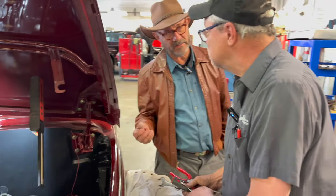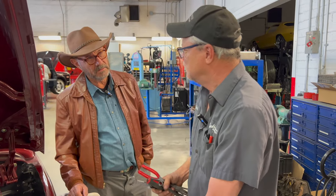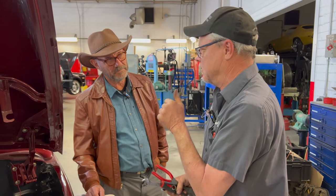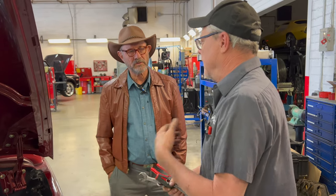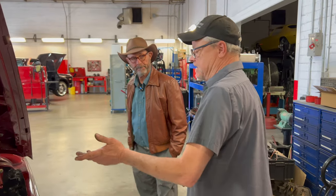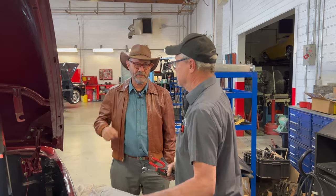Was that the gear hitting something? Because I heard it going, eh. Yeah, it's the starter disengaging with the flywheel. That doesn't sound good. It could be how sensitive I push that button, because we're engaging it, and then as soon as I let off the button, it's disengaging. If I hold that button on a second too long, it's applying. Moral of the story is hit it and let it go. The nice part is that now that its carburetors are working, it starts so easily that it shouldn't be grinding. Right.